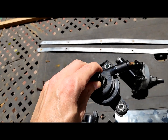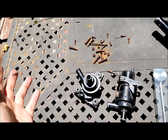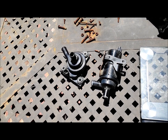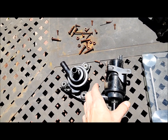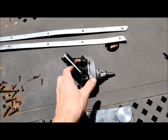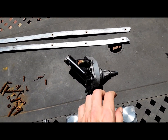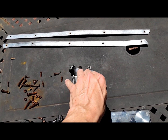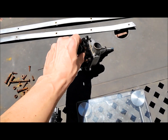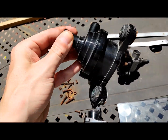Using electric pumps is actually going to do two things for me. First, I'll be able to circulate coolant with the engine off and cool the engine when the bike is stationary. Second, I'm going to get rid of some mechanical losses — the engine spends power to spin this pump, it has quite a bit of drag, and the higher the RPM the more drag it puts on the engine. Next let's measure the smaller electric pump.